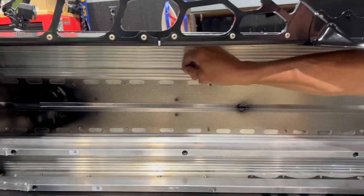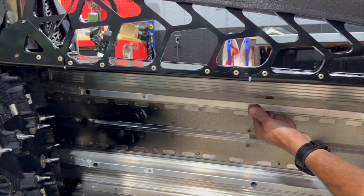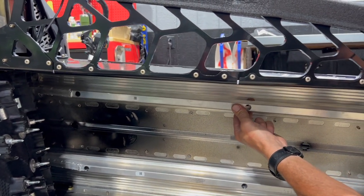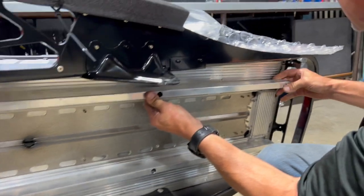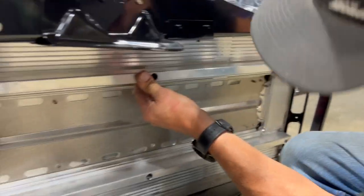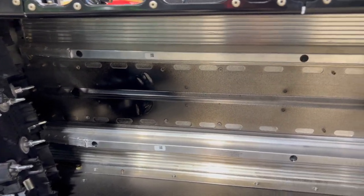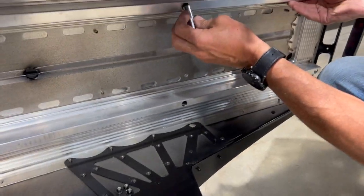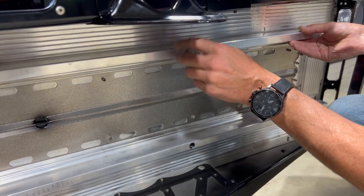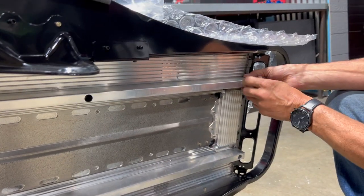When you put those in, you slide them up and line it up with the bolt hole. Once you catch the first one, you line it up here, and then catch the second one, then the third one, and then the fourth one is behind. Okay, so now they're there. All you need is a deep 10 mil socket, quarter drive preferably, because you've got to be able to fit it in there. You need to be kind of quick so that you don't lose the nut inside there, because then you've got to start all over and knock the nut out as it drops.